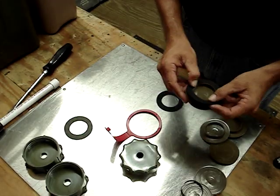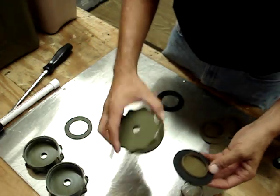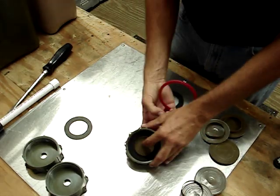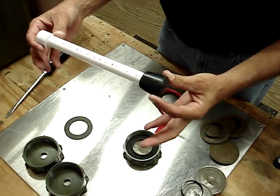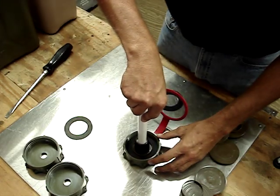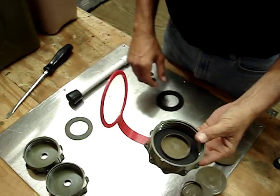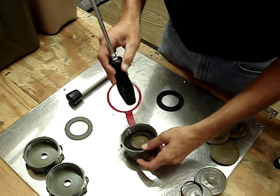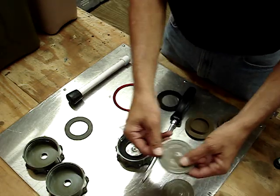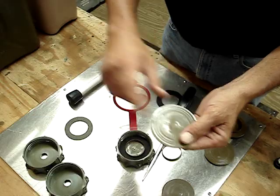So let's do a quick reassembly of a cap. Put your viton gasket back on your flange if you're going to use gasoline. Lay it inside your cap so the button is facing through. Put your strap so it lines up with that, and put it on a hard surface so everything's lined up together. What I've chosen to do is take a half-inch piece of PVC pipe and put a little furniture foot on it so I can apply even pressure and not have it slip off. So you press down — once it snaps, it's back together. If you use something hard like the back of a screwdriver, it can slide around and slide off of the button area, and that is what causes cracks like these little cracks at the outside of the button — probably from a tool that slipped off and put pressure on the side instead of in the middle when reassembling a cap.